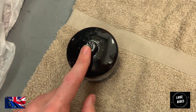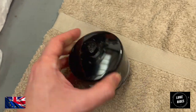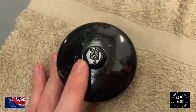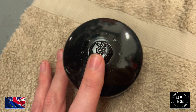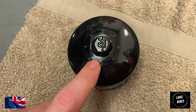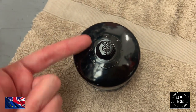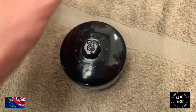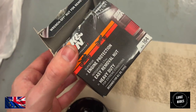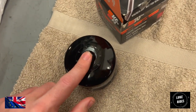But this nut is not for tightening the oil filter — it's for taking it off. That's the mistake everybody makes. When people torque the oil filter on the nut, that's what weakens these seams and welds, and then oil can find its way out and the filter can fail. Because everybody forgets — look at the packaging. It says to ratchet it off, not to tighten it up.